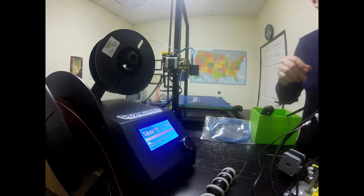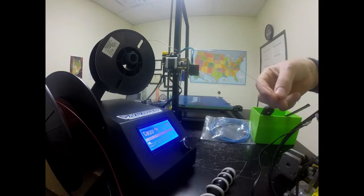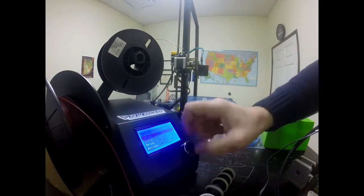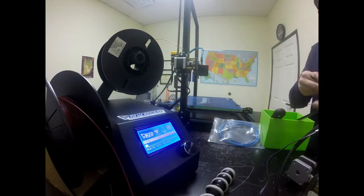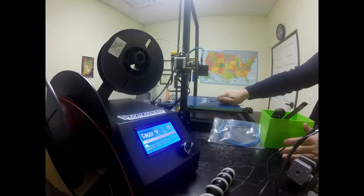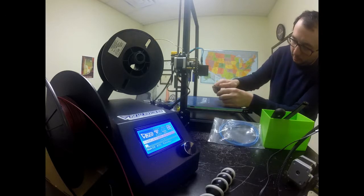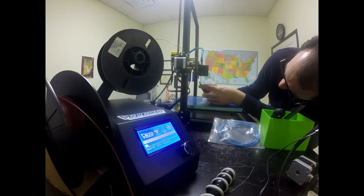The last thing we can do to clear a clog is use one of the unclogging tools that comes in your toolkit. With no filament in the printer, tap the button, click setup, and go to preheat PLA so it'll heat up to 220. Then grab this tool along with a pair of pliers so you won't get burned, and actually floss out the nozzle by inserting it up inside the nozzle opening. You can guide it in with the pliers so it goes inside the tip of the nozzle, and that can push a clog out from inside.